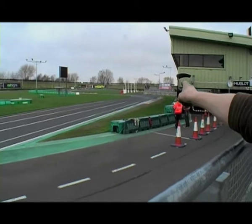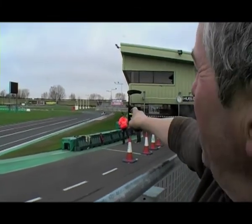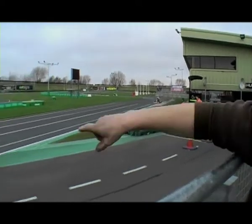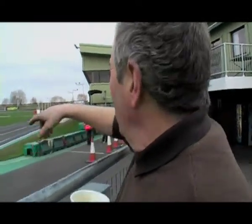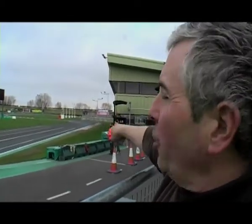If you watch the car, you can tell whether they've got more front-end grip or less — like he's got not much front-end grip yet. If you watch George, the car will turn into the corner better, but his back will drift a bit, and that's telling me we've got the pressure slightly too high on the back.